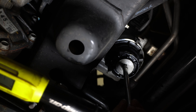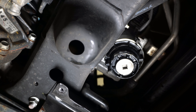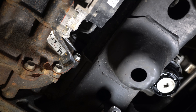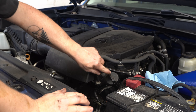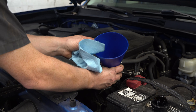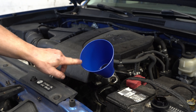The little drain plug gets torqued to 13 foot-pounds — technically it's 12 and a half, but we'll hit it with 13. I'm going to leave the skid plate down for now because I'm going to fill it up, run it, and then check for leaks. So now we can go ahead and fill this back up — here's our fill cap, unthread that. I've got these fancy spill-free funnels that make it easier. They're pretty cheap on Amazon, like 20 bucks, if you're going to do this often.